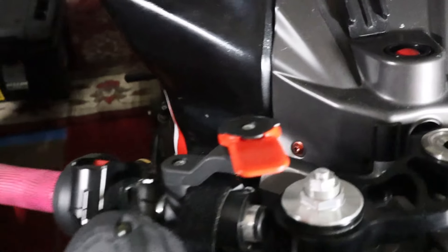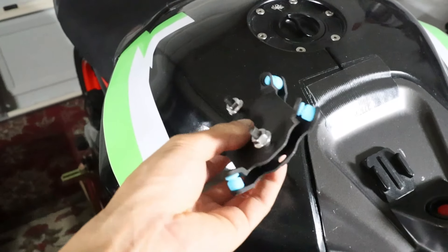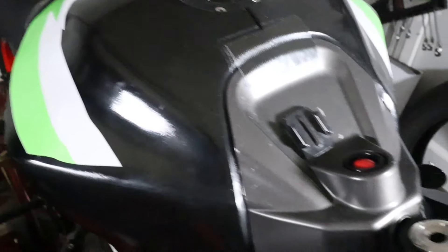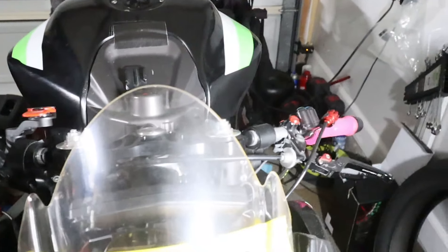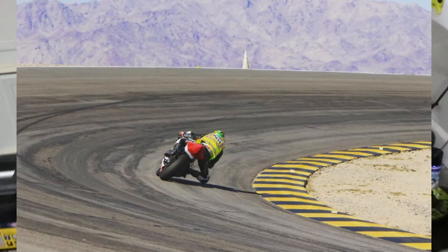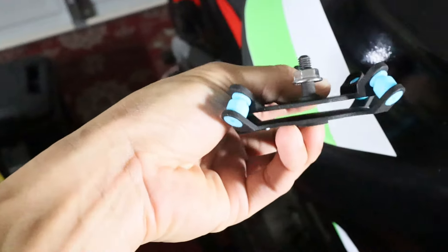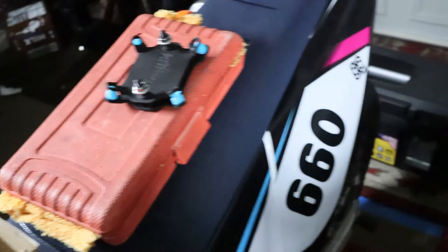Today I got my camera because I'm doing some updates on the bike. There's a notorious issue I made a video about before — I need to put on this IMU damper. It has a rubber spring action. I've been getting that alarm error because the IMU goes out of whack with too much vibration or G-force. I trigger the dash alarm when hard braking or going into a heavily banked turn like the Bull at Chuckwalla.